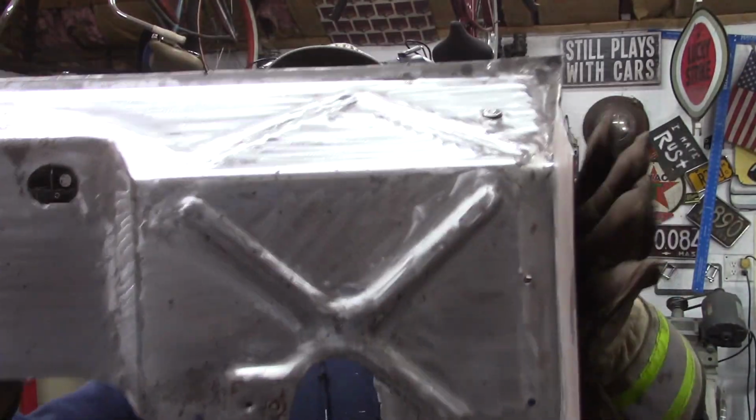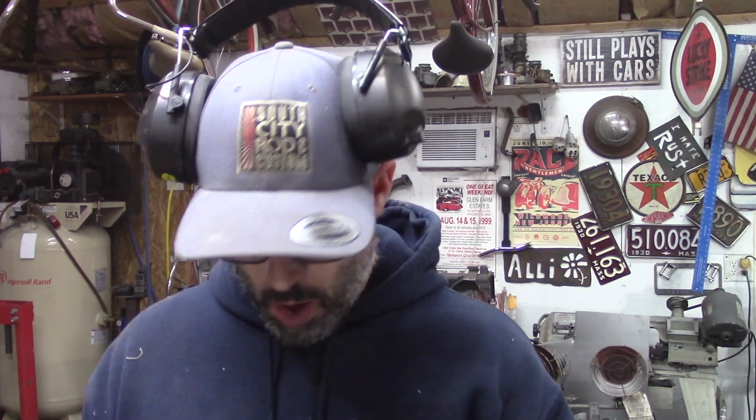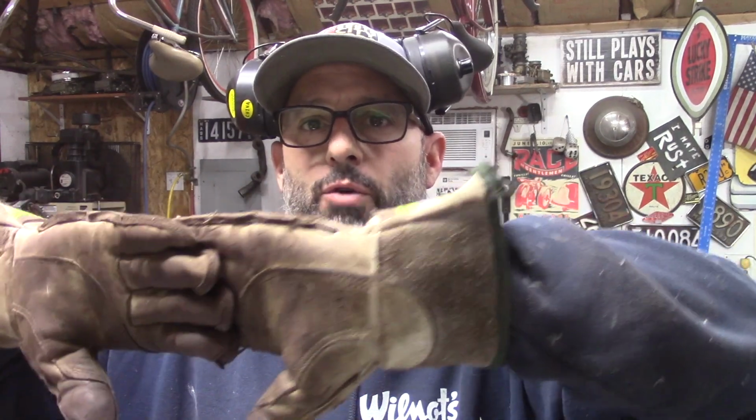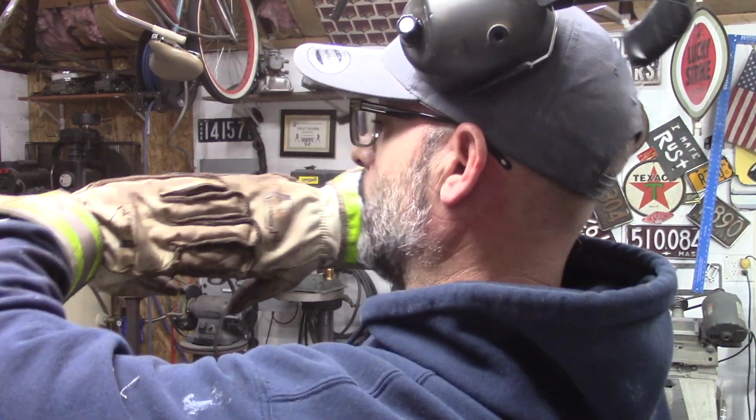All right, so, boom. Got this all cleaned up. Obviously, I didn't do the back. Like I had said before, I'll run that through my sandblast cabinet. But what I wanna do is, I want to get this set in place in the firewall, get it clecoed back in. Well, I probably won't be able to cleco it back in. Yeah, maybe I will. But then what I want to do is make my line, figure out exactly where I need to cut both halves because they're going to overlap, like I said. So I want to get them to overlap, cut it straight down the middle, and then butt weld them together. That's what I'm going to do. I don't know if I'll get it all welded up tonight, but I at least want to get it to a point where it's kind of ready to go. So maybe then I can work on it this weekend.